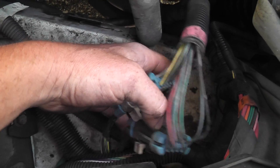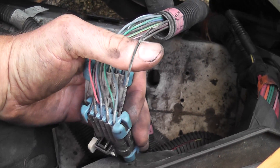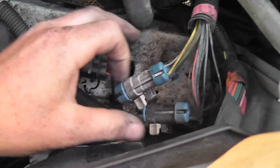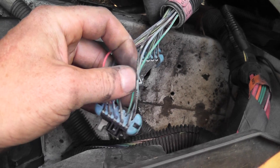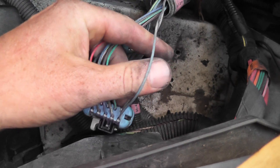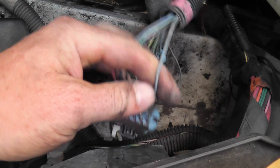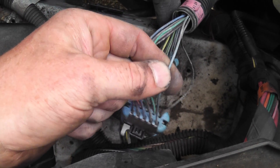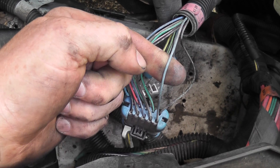The connectors I'm looking for are right here. Knowing system designs means knowing where to go and what to do next. I'm pretty confident that it's the light blue control wire right here on this one connector — that's the control wire for all of my fuel injectors. So I'm going to put an amp probe right here and measure all the injectors firing at the same time. This is a group-fired system, and I want to see what my amperage waveform looks like.